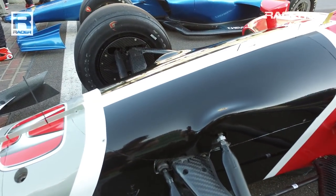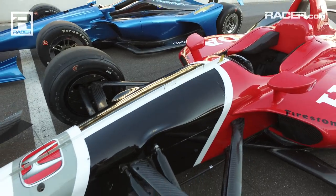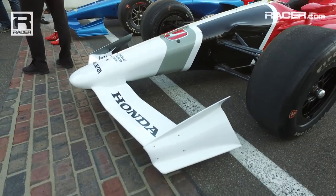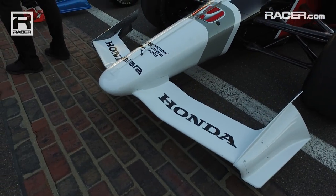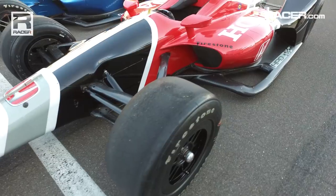You'll see the central spine — the central wicker. It's a carryover from the Honda last year; it's on both cars. If you look at the curved profile of the DW12 chassis in the nose, it's round, and in a crash and a flip, air loves things that are round and will lift those things up. So that central wicker is meant to disturb the air and slow that from happening.